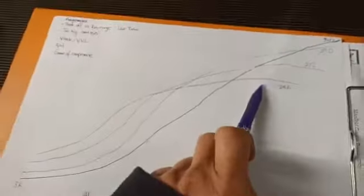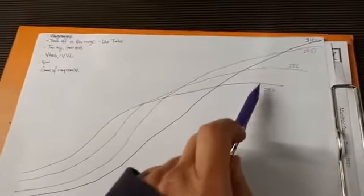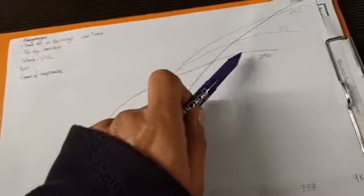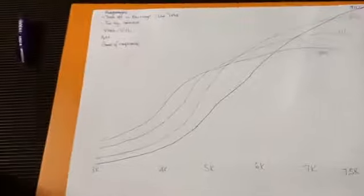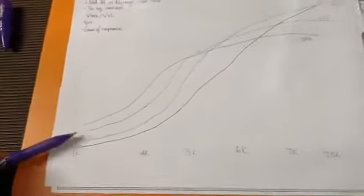So our first one that we're going to look at is, let's say, our 256 degree cam. So we're peaking power here. Now you can see that this cam compared to 272, we're all peaking at different points, and also more importantly at different RPM points. So we look at, say, the 256 cam. This is what it does. So we start with power here, okay, and then 256, that's where we are. So let's say that next size cam up. Again, this is just for argument's sake. This is not an exact size. I'm only doing it to illustrate the point. But let's say we've got a 272 cam.